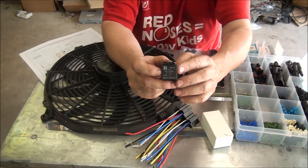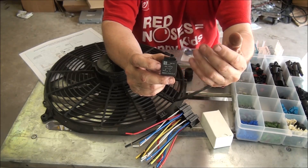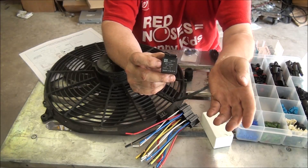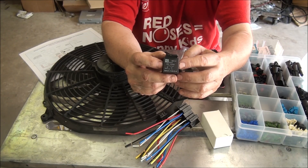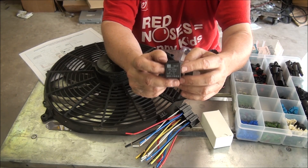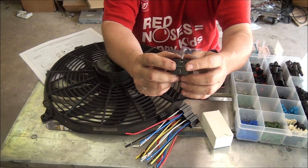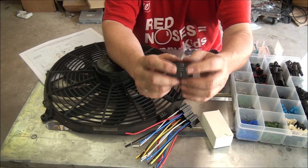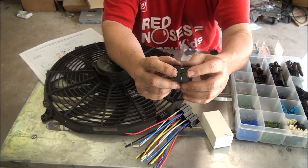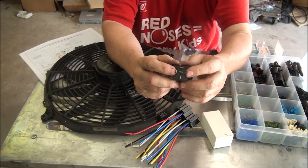I've also got to address the fact that this does have a coil in it. When you energize it, it makes the points. When you de-energize it — take the power away — the points go back to the normally closed position, and the electromagnetic field in that coil will collapse. When that happens, it will induce a reverse voltage into these terminals. Usually that's not a problem on an older car with incandescent bulbs and no electronics. But when you're dealing with electronics or LED bulbs, I think I actually fried my controller for the fan because that coil collapsed and caused a back voltage into it.